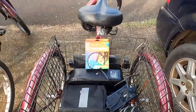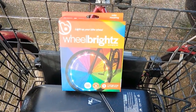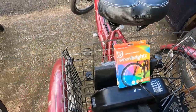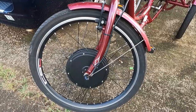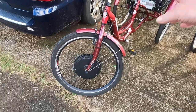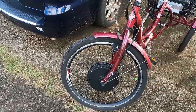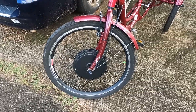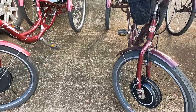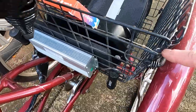Lesson learned: no light kits on the wheels. These light kits are fun and can help with safety riding at night. However, in the long run I would not recommend putting them on the wheels. By the time you've invested quite a bit of money in your electric bike, it's more than a toy — it becomes a tool. If you put an electric bike kit light on the wheel, it's going to be a little wobbly, always a little off-center, and over time that puts extra stress and fatigue on the wheel itself.